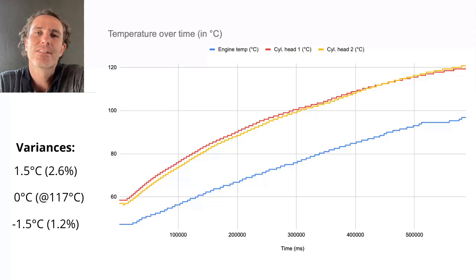One final thought: comparing this to the infrared thermometer, the scan tool seems far more reliable because it reads what the engine sensors actually measure. The problem with the IR gun is you measure different spots that are all different types of metal, in or out of the shade, and at different distances from where combustion happens. So the temperature readings from the gun are very unreliable and difficult to compare side to side — that's why I like this scan tool: the information is just more reliable.